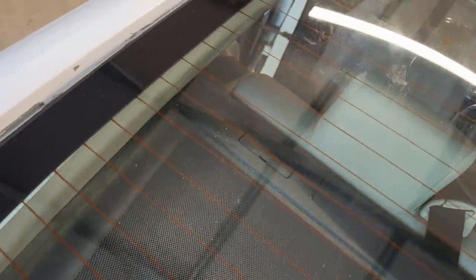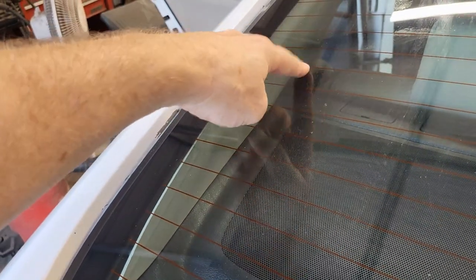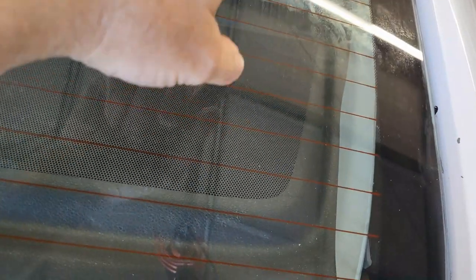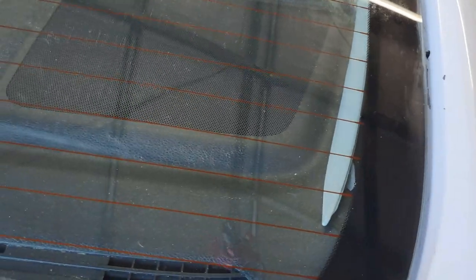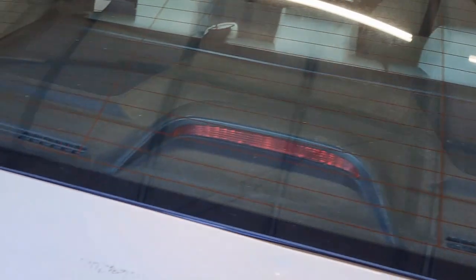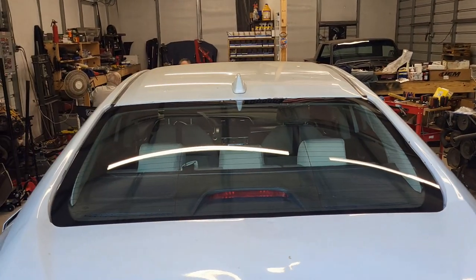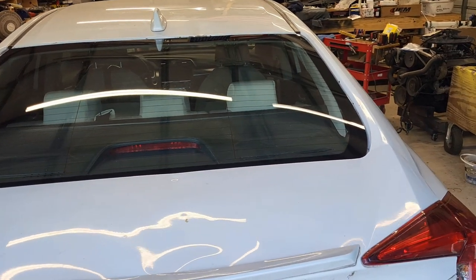One of the things I wanted to show you: I got the trim piece back in here, but before you put that in you have to hook up the rear defroster plug — there's one on both sides. I've already done that, but I just wanted to remind you guys: before you put your trim piece back in, make sure you get that rear window defrost plug hooked up on both sides. This one's all done. I'm going to go ahead and wipe it down and clean it up — there's the final product, all cleaned and set. It's not fully cured but we're not going to drive it until tomorrow anyway.